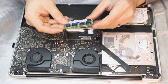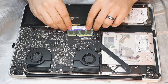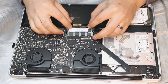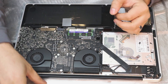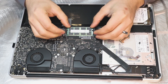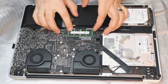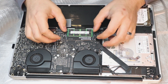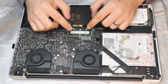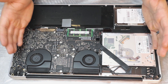Now all we do is take the first one on the bottom — you'll see where these little edges line up. Come in almost at an angle, push in, and then push down, and they have a nice little click that goes in there. Same thing with the second one: come in at a little bit of an angle, slide it in, push down, and then pop the tabs back into place on the sides. If you want to double-check they're fully seated, pop these tabs off and you'll see it pop up — push it down, locked into place. That is literally it. The RAM is now upgraded.